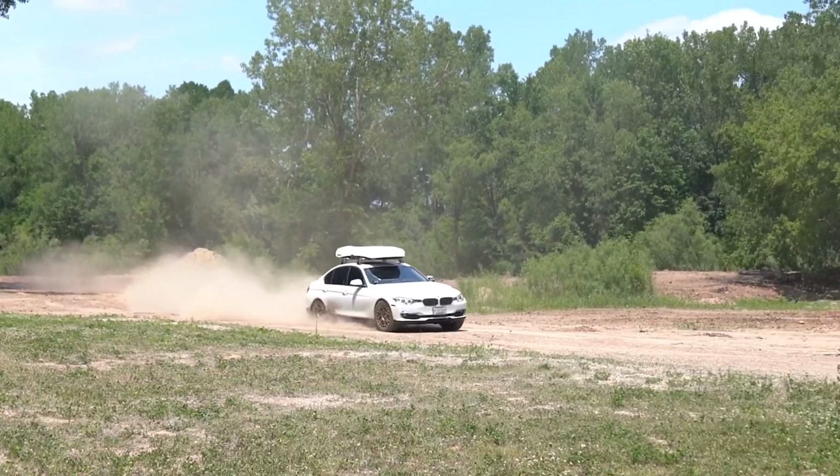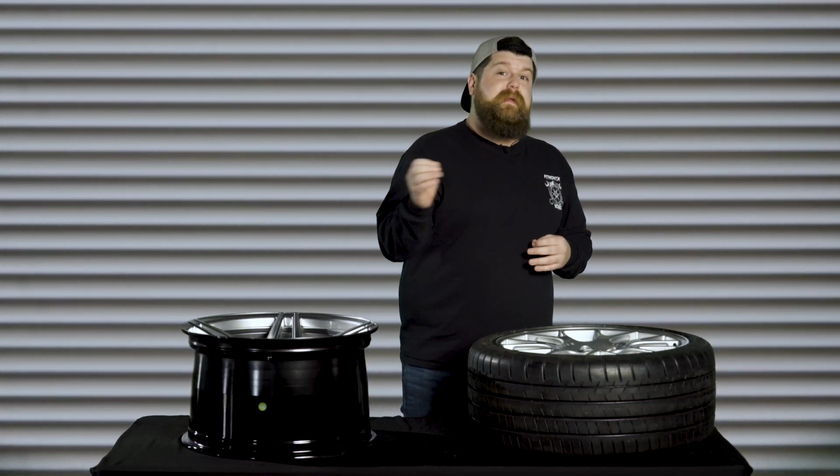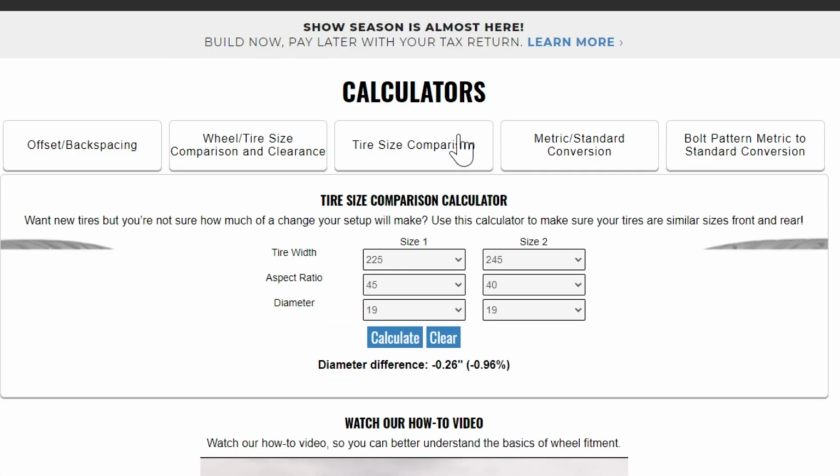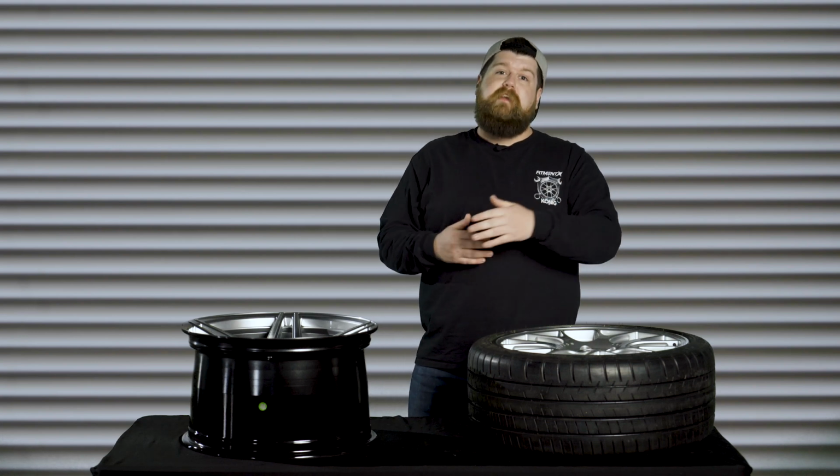Now, unless you're doing some sick off-roading here, the general rule of thumb is to stick as close to your stock overall diameter as possible so it doesn't mess with your speedometer or anything like that. So what you're gonna wanna do is head over to fitmentindustries.com and pull up the tire size comparison calculator that I'll link below and punch in your stock tire size. If you already had aftermarket wheels in your vehicle, you can refer to the information sticker located on the car's door jamb or gas cap to find your factory recommended sizing.